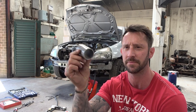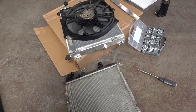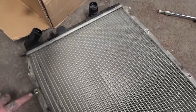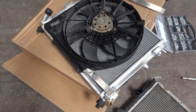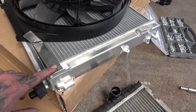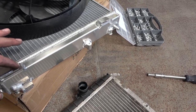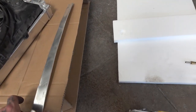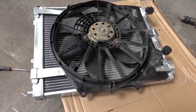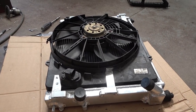We've encountered a little problem with the Toyo Sport radiator — the fan bolts onto the factory radiator but the Toyo radiator doesn't have the fixing points for it. So what we're doing is fabricating some L-brackets to go into the sliders — the sliders are what normally hold the aircon radiator in place. We're using the guillotine to cut these aluminium strips. Okay, so we've knocked up the brackets — quick 10-minute job to be honest — and yes the fan still spins. There are no rivets interfering with the blades, so that's ready to fit.